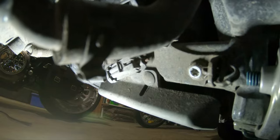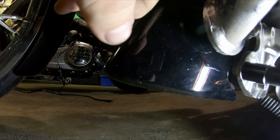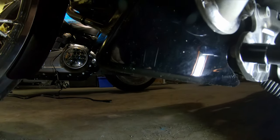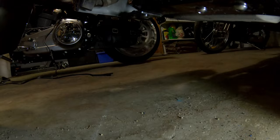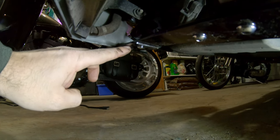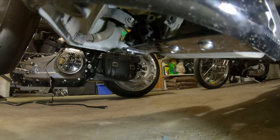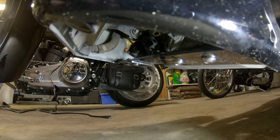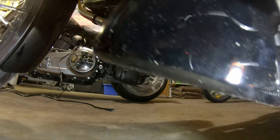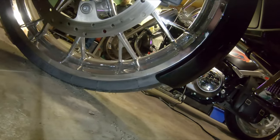As you can see, it's on two Allen bolts that replace the torx bolts we took out. Those are a 7/32nd. Then under here — these two and these two down here — those are the little guys and they're a 5/32nd. Everything's just snug with a spot of blue Loctite just to make sure they don't go anywhere. It's a tight squeeze, so I did have to use an extension and a couple of small Allen keys to get in here.